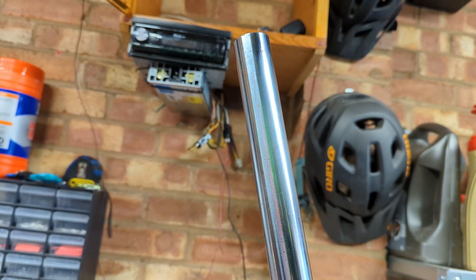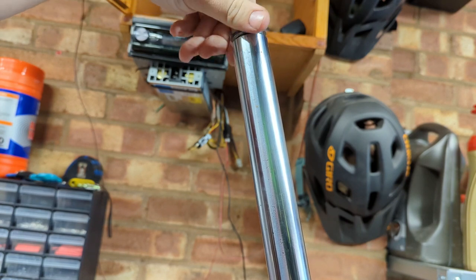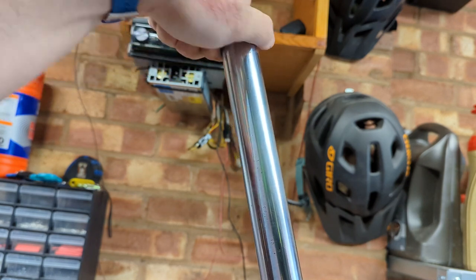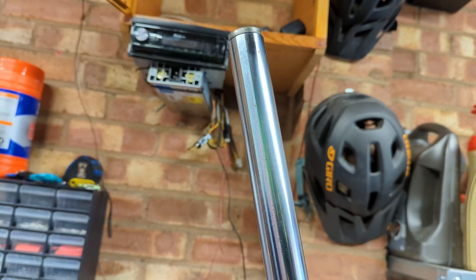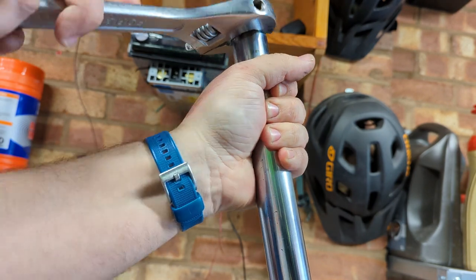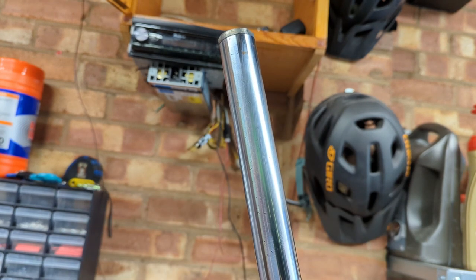It's becoming more difficult to extend my rod as that fluid is finding its way into all the places it needs to be. I'm just going to pop this cap in. Actually, there's a little bit of muck on the threads there. You don't want any muck inside this anywhere. There we go. Screw the cap on. Doesn't need to be monster tight, just tight enough to ensure that the seal is made and that the oil is going to stay inside the tube.